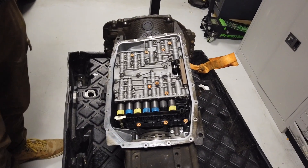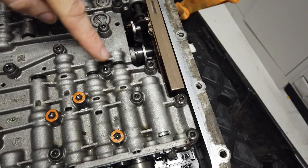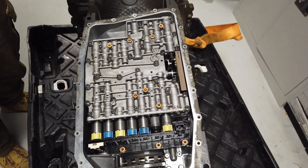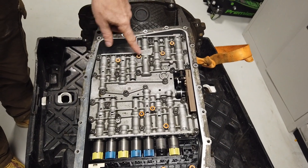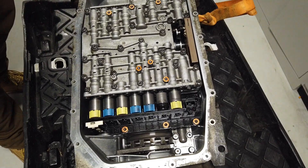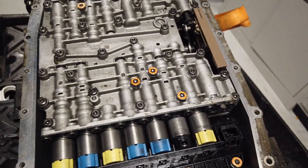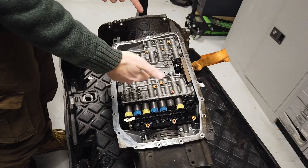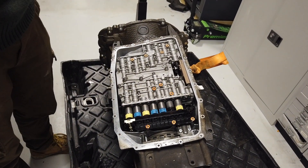We've done a little bit of prep - there's a load of Torx heads down here and some of them are bigger than others. Dan worked out which ones to take off and we've colored them in orange. Basically the orange ones are the big ones. The ones you need to take out are more rounded - you can tell the difference. You'll be lying on your back under your car looking up at this, taking it out of your old gearbox to put into your replacement one.